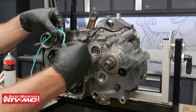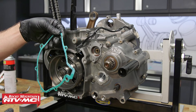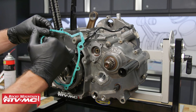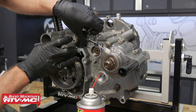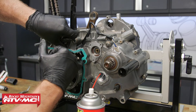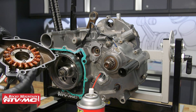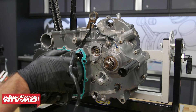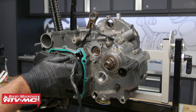This is just my own preference, but I like to put a little grease on the gaskets so if I ever have to take this cover back off the gasket probably won't stick to both sides. The only thing I will do is apply a little bit of silicone to that grommet and leave it dry around that silicone area so we get a good seal where that meets up. Then we can install the two dowel pins and put the gasket in place. On the cover itself, just where the grommet meets the corners, apply a little bit of silicone on each side. When you put the cover on, have it lined up as close as you can — that magnet is going to pull it on pretty hard, so just watch your fingers.